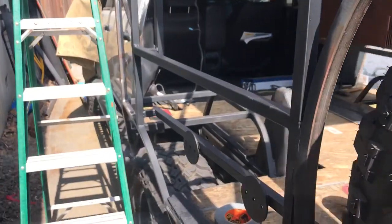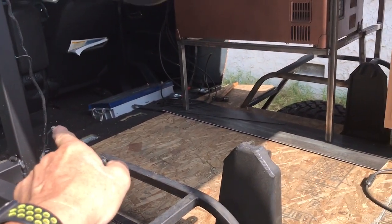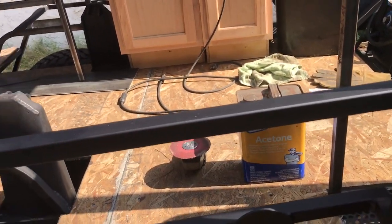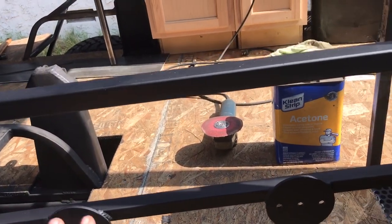I have this painted up and it's kind of ready to go together. On the floor, before I put the lifeproof flooring down, I'll build out and go inside the cab so I'll have extra storage there. I'm going to do the Herculiner bed liner on this so that'll seal it — if water did seep in anywhere, as we know, marine grade plywood would be better, but this will all be encapsulated in bed liner. I've found from the past that's actually not a bad way to do things — I built some boxes that were out in the elements for about a year and a half with absolutely no water damage.